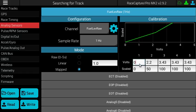The next step is to fill the tank up to 50%. In this example, we measured 2.2 volts at the sender and then we set that to 50%. When the tank is full, we measured 3.43 volts and we set that to 100%. The remaining cells of the calibration table were just replicated with the 100% values.